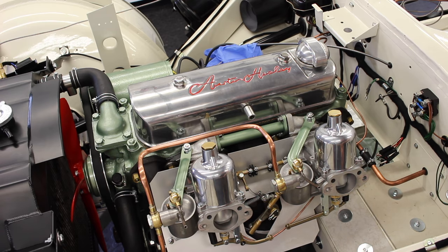Right, when we fired it up initially, the left hand front carb, the piston was a lot higher. Now I'll get it back running in a second and I'll just undo that throttle adjusting screw. Now this is the key point. Carbs are currently independent. If they are linked together and you adjust one, you're adjusting both. They need to be set up independently. I'll just fire it up and then I'll adjust that throttle adjusting screw in and out, and you can see the height of that piston move according to airflow, because obviously you're opening and closing the butterfly, which is further down.